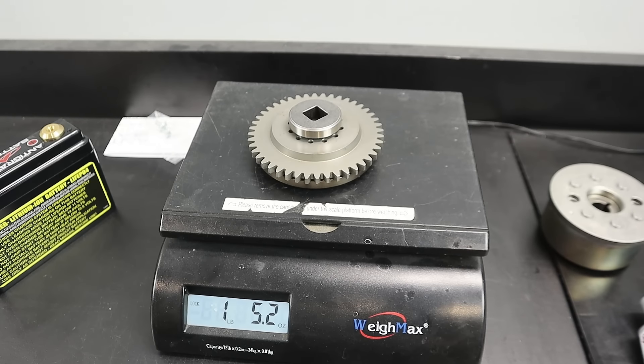To round out my thoughts about weight: if you guys are doing a build from the ground up where you're considering your total rider weight, your skill level, and having your suspension valved, it would be worth considering this when getting your suspension resprung. Your suspension company knows the bike's weight as a known variable — now you have an extra roughly eight pounds. For most people it probably won't affect much, but if you're a stickler for every little detail, this is something to bring up to your suspension tuner.